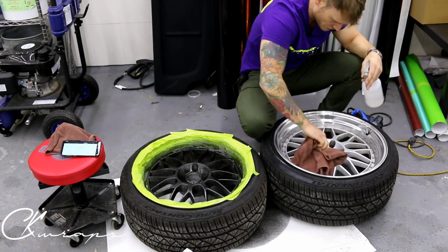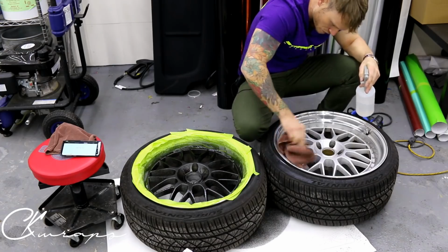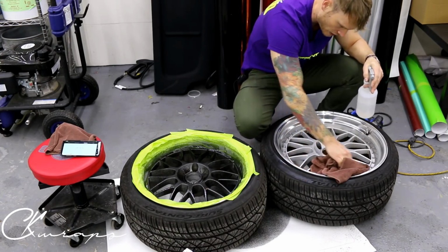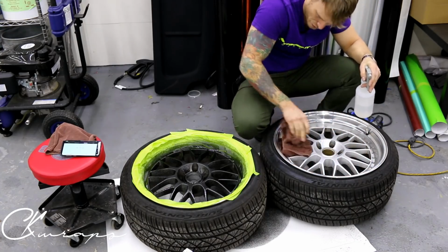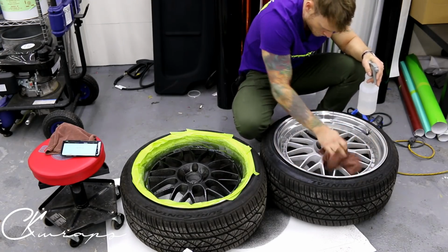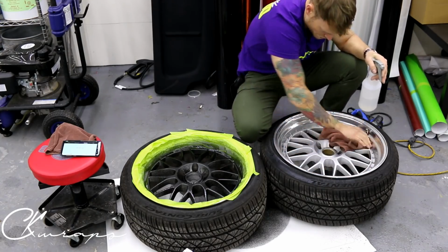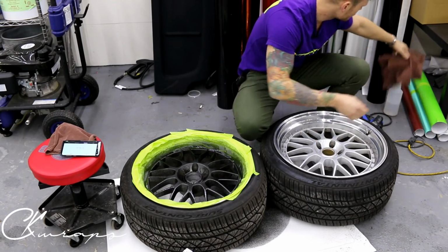That's still drying, you can see it's wet. You can't do your coats too soon, otherwise it gets to be too much buildup, it can run and just not look pretty. I know it's gonna have a lot of orange peel in it anyways, because that's Plasti-dip for you. Cool, I think we're good. Let's see if I get these scuffs out. It's gonna have some imperfections in it, whatever, it's a wheel. I'm not too worried about it.